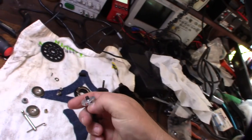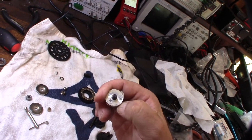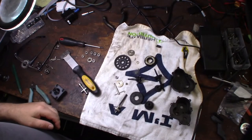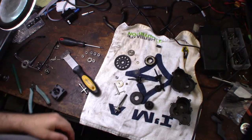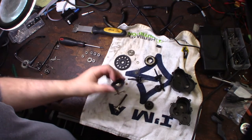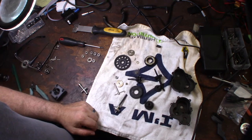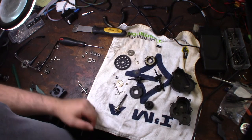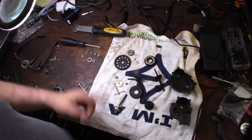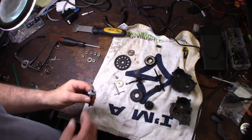After cleaning, I did some research and it actually makes sense. Nylon gears — you don't actually want to lubricate them, you don't want grease on them. It just creates more resistance. Think of a plastic servo: if you ever take one apart, you never see grease on the nylon gears. Whereas if these were actual metal gears, then you'd want to grease them. But cleaning it out really let me figure out how the two-speed operates.